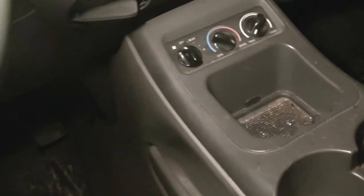The first thing you have to do is put both your seats all the way back on the passenger side. We have to take out this center console — mine has a CD changer in it and I've had it out before. It's not that big of a deal to pull out, but I'll show you some of the bolts. Once we get this out, we can start working on the dash. We have to unhook a lot of stuff in the dash and have the passenger side swing forward so we can get in behind there and pull that heater core out and replace it.